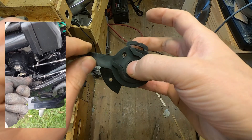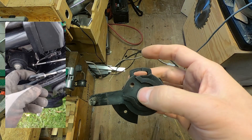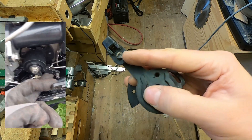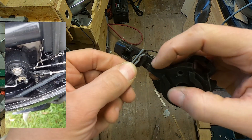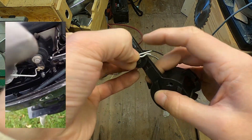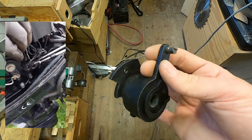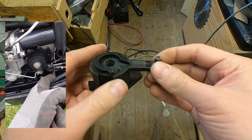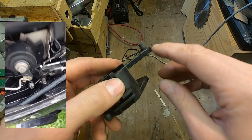When I disassembled the throttle cable linkage, I broke off the plastic tip where the retaining clip goes. I could just order a new one, but this is a common problem and I'm afraid that it's just going to happen again, and that would be annoying. So instead I'm going to replace this bit with something made out of brass.